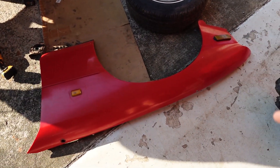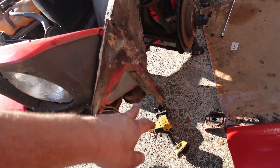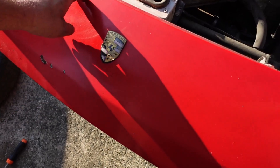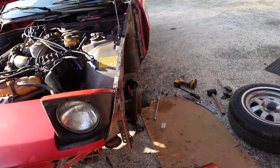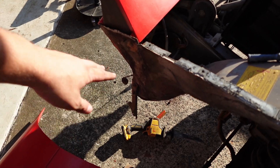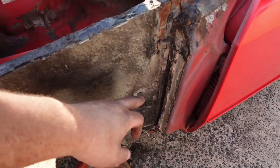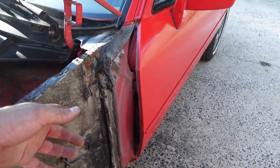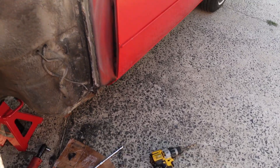Making some pretty good progress. I found a few differences — I may have to go back to that 944 and grab different brackets because I think these brackets are different. Also the nose cone is actually different, which surprised me, so I may have to keep my original cone. It's only got a little ding and it's in pretty good shape. On the 944 the nose cone just unbolts, but here it's part of the whole core support. Got the fender off — there are a few bolts down here that attach to the front valence, one bolt right there, bolts along the top, and three inside the fender. You have to pull your antenna motor off if it's a 924 — I'm going to delete mine since the 944 doesn't have one.